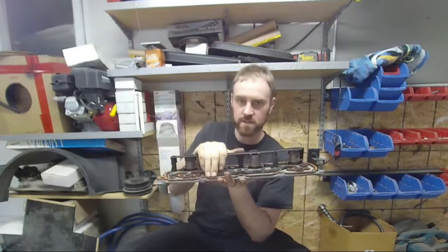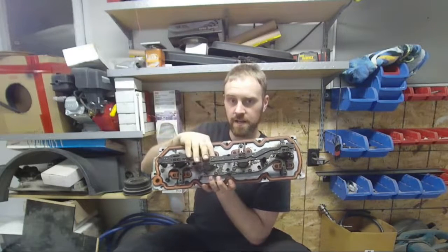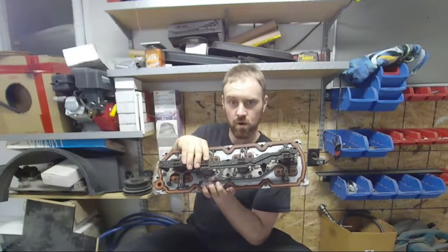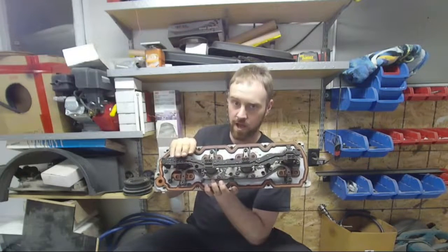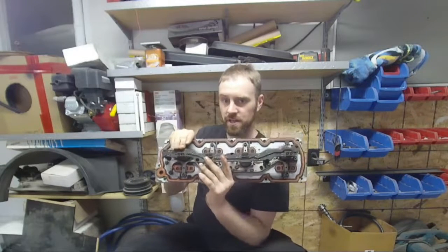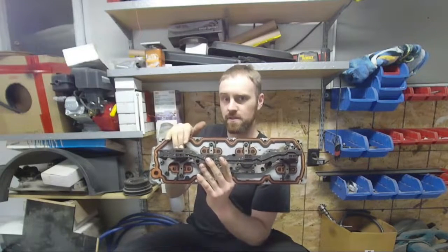Now, if you pull these solenoids off and you pull the gasket out where these are, that's fine and dandy. But if you need to leave this hooked up so that you can go down the road to get to a tuner, it will run like crap when it goes into 4-cylinder mode, but it will be able to drive. If you need to hook this up so that you can get to a tuner, there is an option available to do that. Basically, you have to leave these in place.